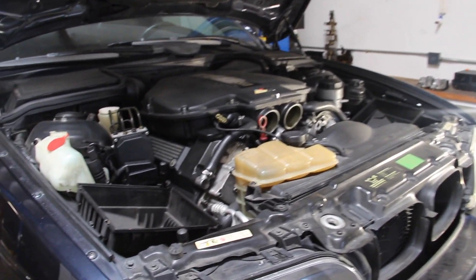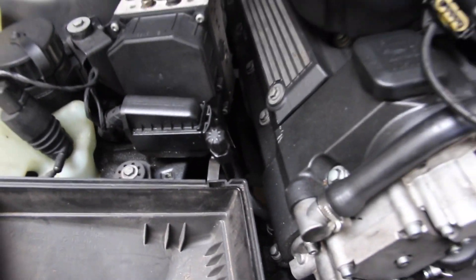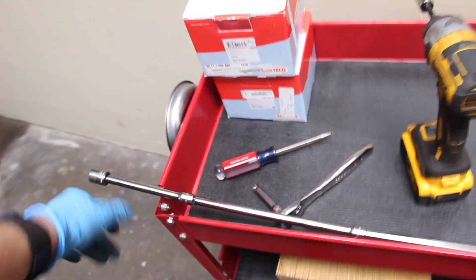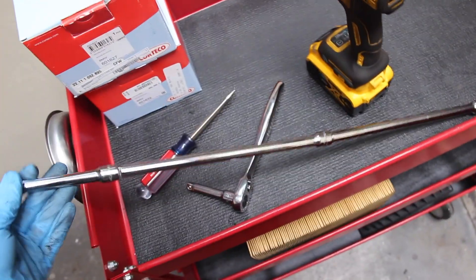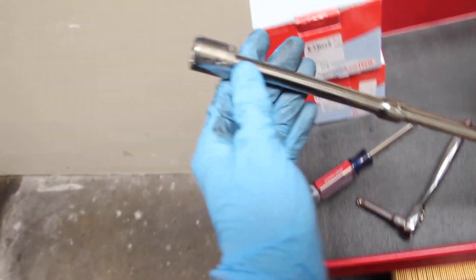The upper boxes are out of the way — that's an easy, quick two minutes. It's probably not completely required, but it does buy you some space, which is nice. Now looking here on cylinder bank one, passenger side, we can look down and see where the engine support arm sticks over. Down by the AC line is the 16mm nut, so we're going to need a decent setup of extensions.